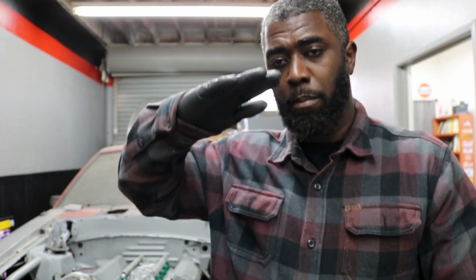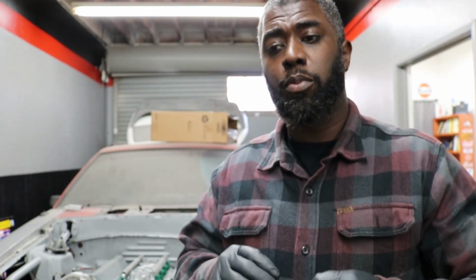And I also gotta start to think about the cap, how I'm gonna machine the cap, because the cap can't be welded in. It's gotta be to where I could bolt it down, and also will provide a point to maybe break a gasket or something in case I get a backfire or something like that, right? So I'm gonna use the cap for that. I think it would be the best place.